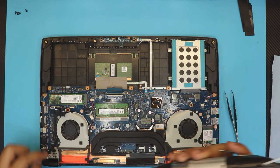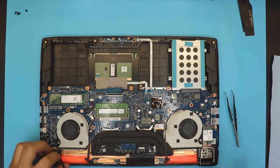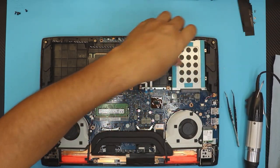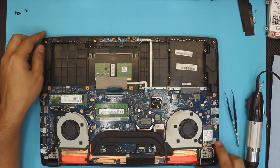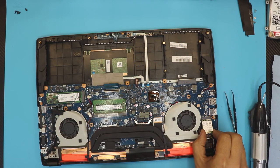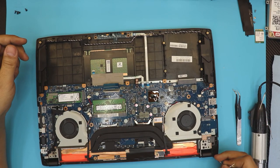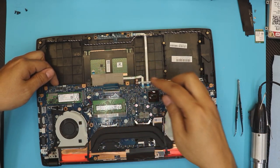There's a screw holding a cloth piece there, so leave that for a second. Remove the hard drive by removing the four screws that hold the caddy, then slide the hard drive towards the front and pull it up. Next, remove the Wi-Fi board from the corner — pull it out at a 45-degree angle, then pull out the cables. Remember the white goes with the white and the black with the black, though it doesn't really matter if you swap them. The NVMe hard drive we're leaving in place.